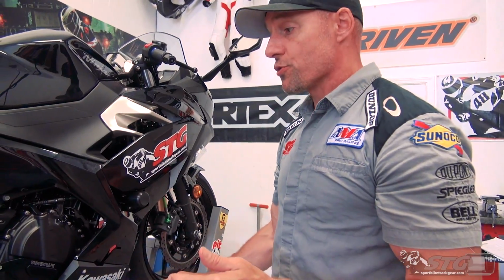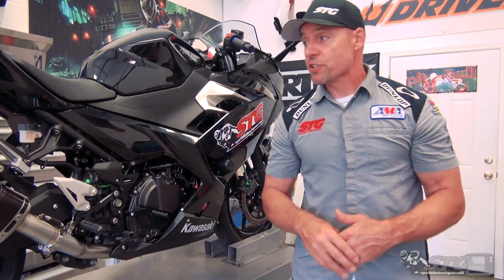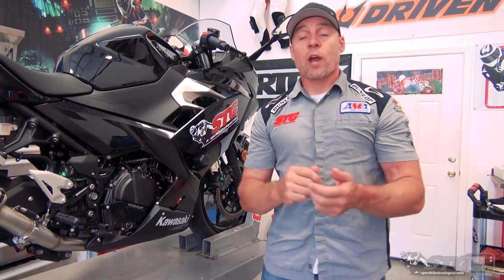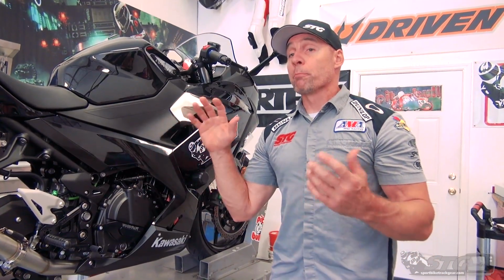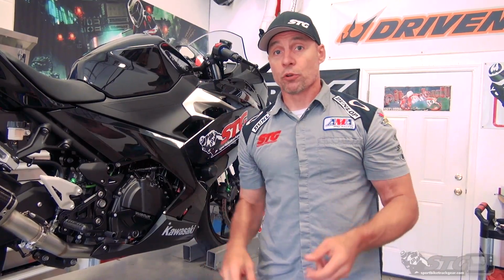Do I have to install a fuel controller? That's another big question that we get. The answer to this is very simple. To get the very best performance out of your investment in the exhaust system, yes, best practice is to put a fuel controller on or have your ECU remapped to extract all the possible performance benefits out of it. Am I gonna burn my motorcycle up if I ride around with this exhaust system on it because I haven't put a fuel controller or a tune on it? The answer to that is no, okay?